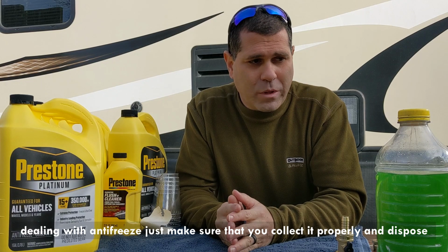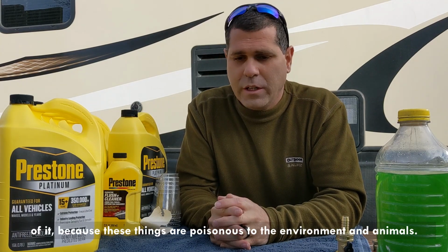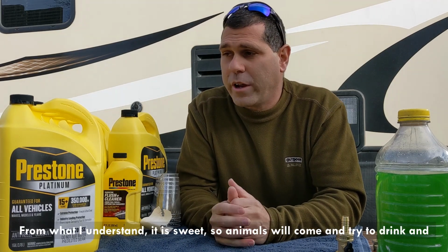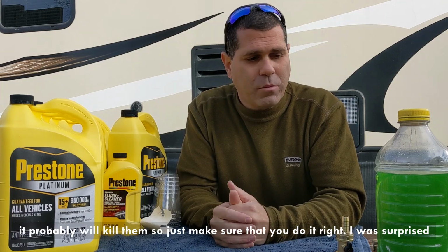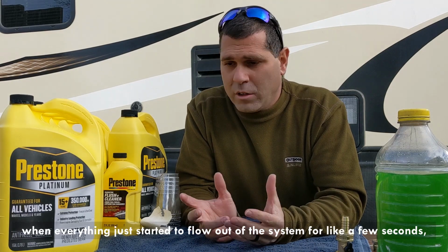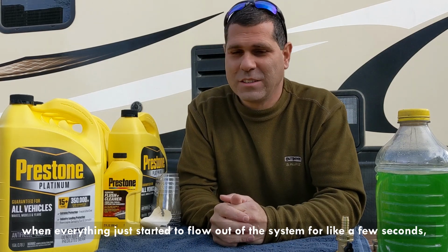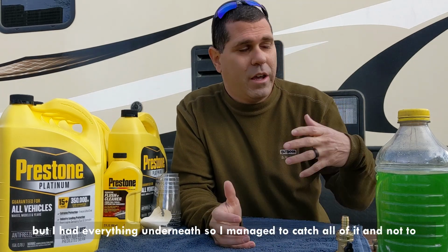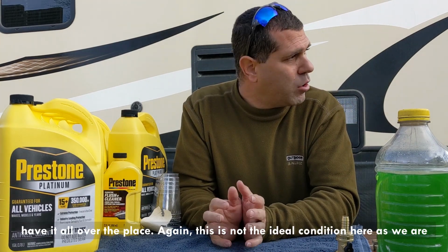Again, guys, if you're dealing with antifreeze, just make sure that you collect it properly and dispose of it, because these things are poisonous to the environment and animals, and from what I understand, it is sweet, so animals will come and try to drink, and it probably will kill them. So just make sure that you do it right. I was surprised when everything just started to flow out of the system for a few seconds, but I had everything underneath, so I managed to catch all of it and not have it all over the place.